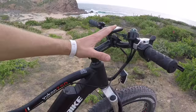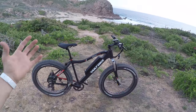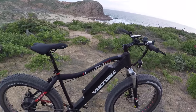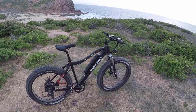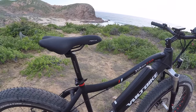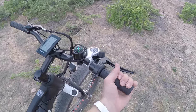One thing I don't love about this design is that it has a pretty long stem angled up a little bit, with a very low rise on the bars. When I'm riding I'm leaning forward more — it's a little more aggressive than I'd prefer. I would probably get a smaller stem and higher-rise bars. Also the Selle Royal Fresia saddle feels pretty firm, but thankfully with the fat tires and suspension the bike softens up. For $100 you can get fenders and a rack, and the 27.2mm seatpost means you could add a Thudbuster or Body Float for more cushion.